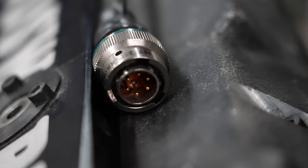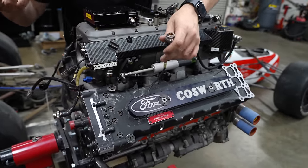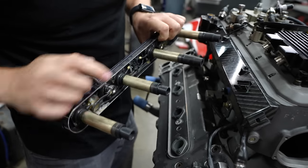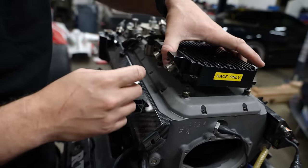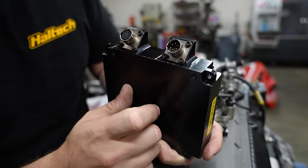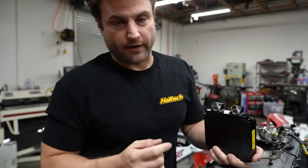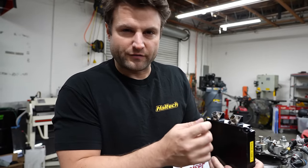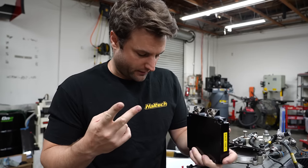I started working backwards. There are six pins on this connector, and four of those are definitely to fire each of the four coils — that checked out. The other two I guessed were power — also correct. It plugs into a box up here, and the same thing is on the other side. Oddly enough they're different sizes, but the wiring checked out. So we know the spark system works that way. Then I looked at the input to that box — all of my ignition is on just six wires. I cracked the box open and found two wires fused together and two more fused together — power and ground. That left only two wires to fire eight spark plugs.